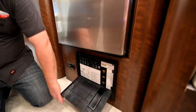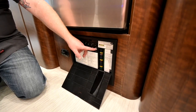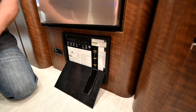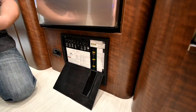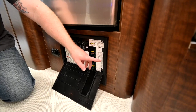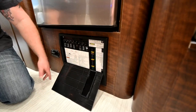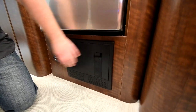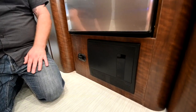Below the refrigerator is your breaker and fuse box. All of your breakers are listed on the sticker. The one at the very end is the GFI reset for all the plugs on the trailer — you must turn it all the way off to allow it to reset, and it will not reset if you're not plugged into a 110 power source. All of your fuses are standard side-blade fuses in various amperages, listed on the sticker to the right. When one of these goes out you're going to get a little red LED light next to it that you should be able to see through the window. Next to that is your combination carbon monoxide and propane detector — this one is hardwired into the house batteries so you don't have to worry about checking the battery on it.